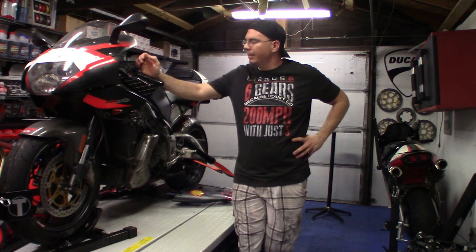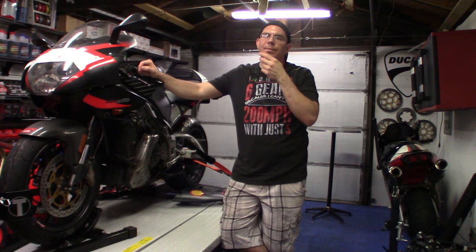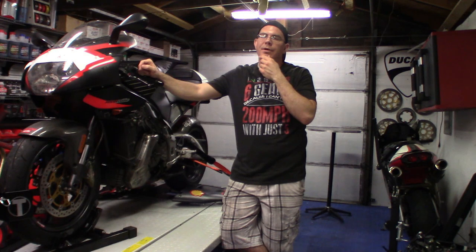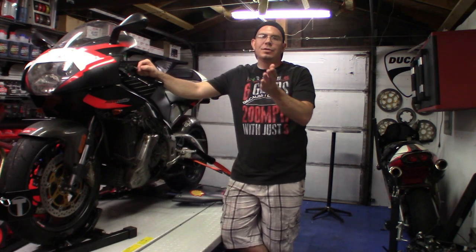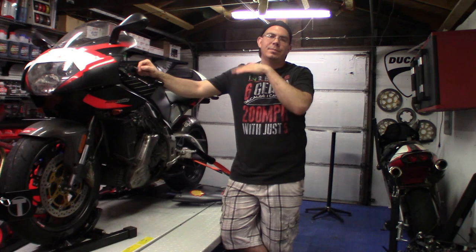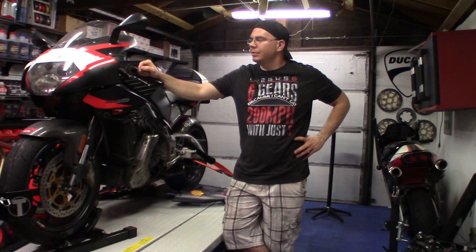The Ducati seals are about the same thing. You know, it's a whole Brembo system. But I actually have an engine over here on the workbench, and I've got an extra master cylinder. So we're going to tear that one apart, and the seal, it's 98 through 2003, all the same year stuff. We'll pull that master cylinder off, get the replacement seal, rebuild it, then pull this one off and install the rebuilt one back onto this bike and bleed the system, and hopefully we'll get rid of the problem. If it's not the problem, it might be the fluid, but I don't think it's the fluid.